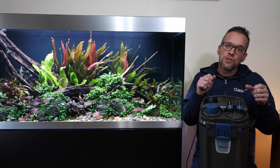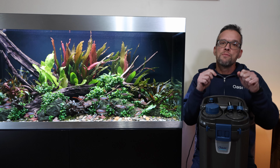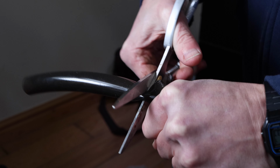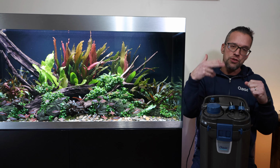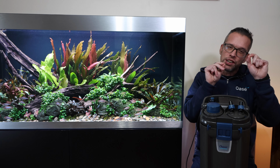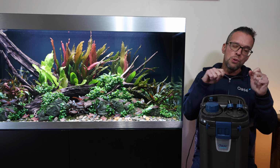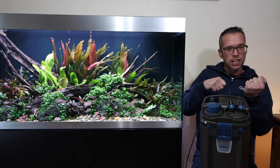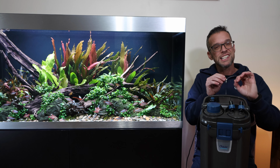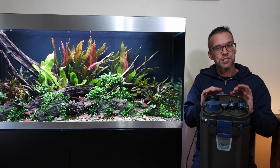Another top tip, when you're fitting your hoses to your OASE aquarium fittings, whether that's the outlet or the inlet, make sure you cut your hose, if you need to cut it to length, perfectly square, perfectly perpendicular. No jagged edges where you've tried to hack it with some scissors maybe, because if you have hacked it, there's little areas where you may get a tiny leak, and that can take in air, and you may potentially result in air bubbles. So it's really important to ensure those hoses are fitted completely snugly, but they're also cut completely squarely. And this ensures a complete 100% hermetic seal between the actual hose and the hose fitment, and therefore eliminating any chance of air bubbles.